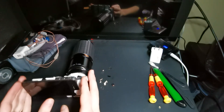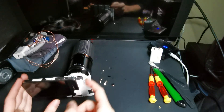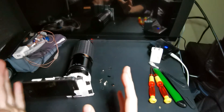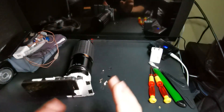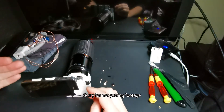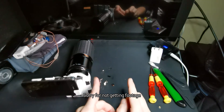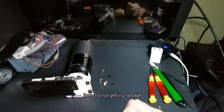First of all, I started with an old iPhone 4s - this one's Wi-Fi and power button do not work, the home button is finicky, so it's not a big loss. This is just a really old spare phone that wasn't getting used. What I did is I took the screws out of the bottom, took the back of the phone off, took the camera module out, and as you can see by all of this junk here, these are actually pieces of the camera module.